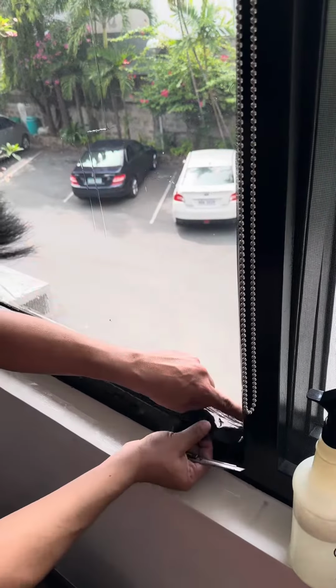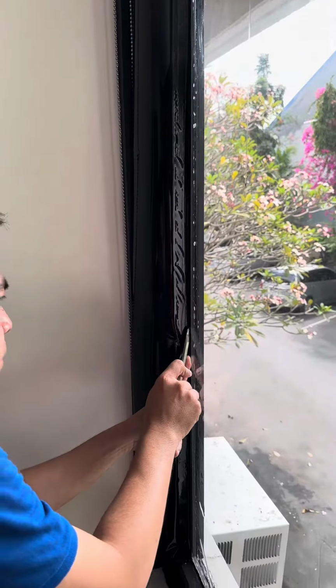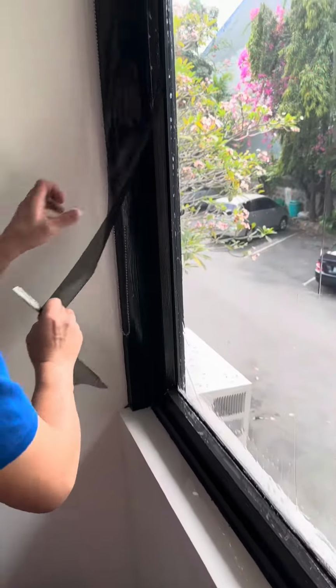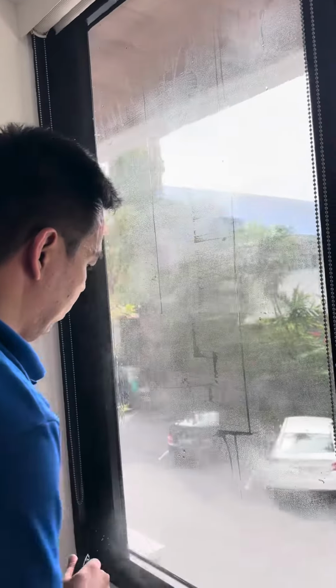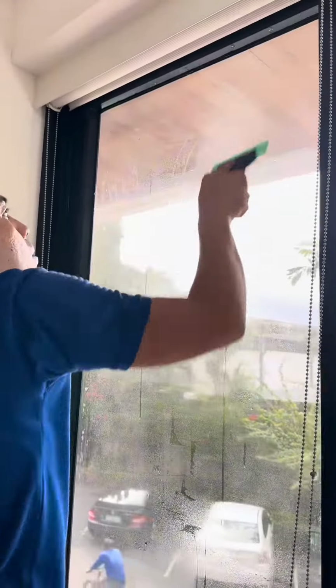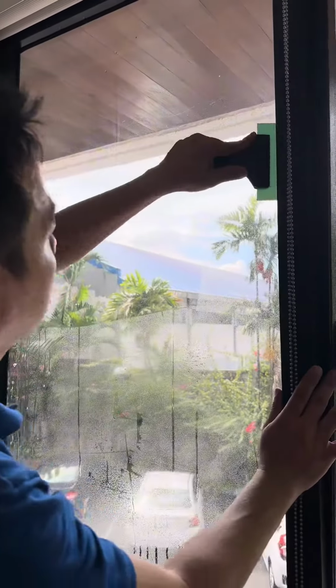And then I take my rag and I go around the outside edges for any contaminants that might be stuck around the outside edges. Then I grab my sheet of film. I use the factory cut straight edge and line up the top so it's perfectly straight up there. I have a couple inches overhanging on the sides and the bottom.